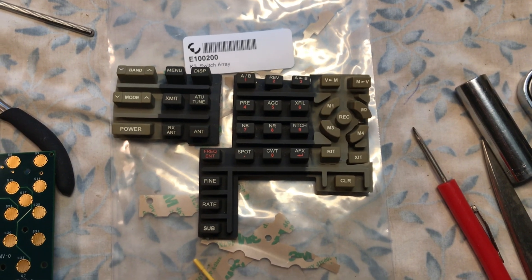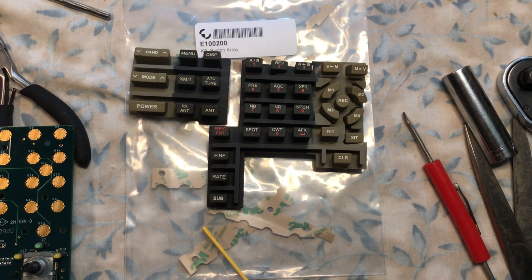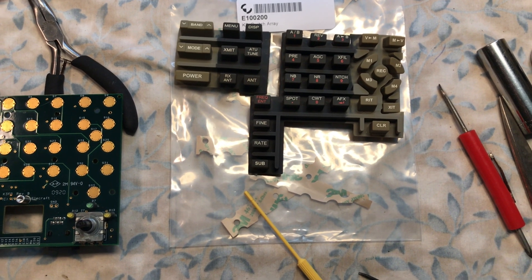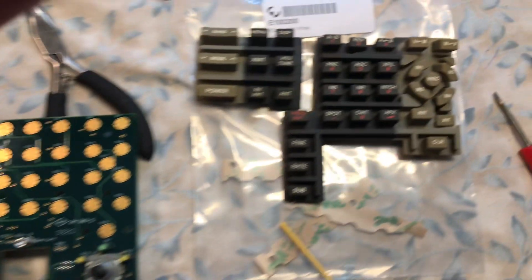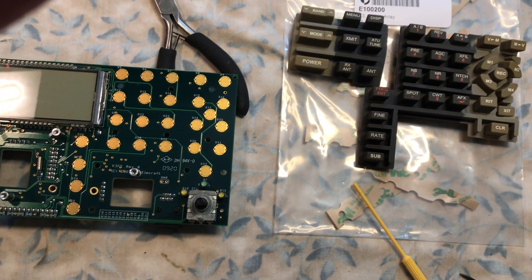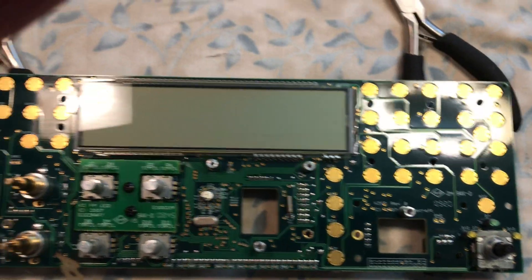When you do this process, here is the new keypad. You'll have to disassemble down to the bare front panel board — this is the bare front panel board. After you remove all the plastic matrix, you've got to remove the sheet metal. After disassembling, you can then attack the rubber and plastic matrix removal part of the job. Under the rubber layer and the plastic matrix, you must also remove that plastic matrix that's glued to the board.